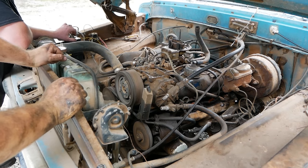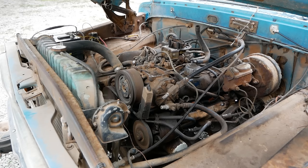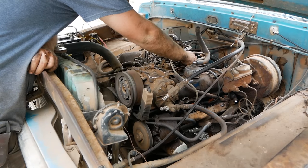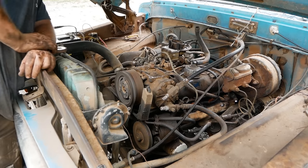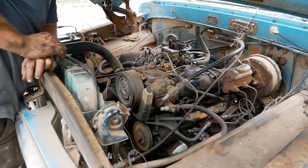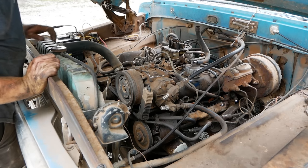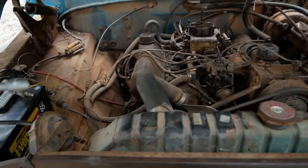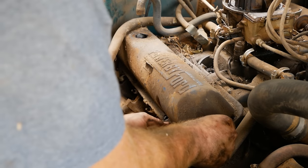Noise on this side, but running. Let's see if I got an oil gauge. No oil gauge or light, so I don't know. Sounds like we got a definite sizable amount of lifter tick over here I need to check into before we go much farther, so let's pop this valve cover off. Man, I picked a shitty day to do this. It's about to get stinky. One thing about the Ford FE is they do not like push rods and they love to bend them.